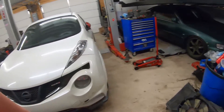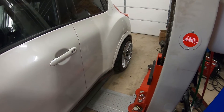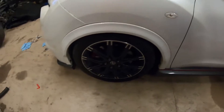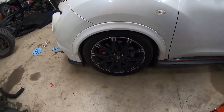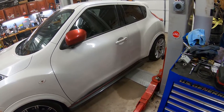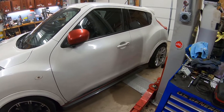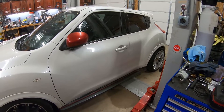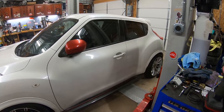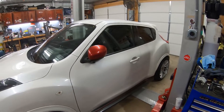I already got the wheels on the back — that's a 255 on the rear of a Juke with a 24 offset. These are 18 by 9.5s, so really large wheels, while the stocks are 18 by 7.5s. The stock wheel weighs 21.6 pounds and the Gram Light weighs around 17.8 to 18 pounds, so it's losing weight on the wheel but gaining some with the larger tire — it'll probably equal out overall. If you enjoyed the video and the Juke content, leave a thumbs up and subscribe to YoSpill. Click the bell icon. You guys are the greatest — until next time!